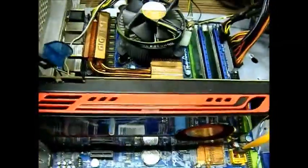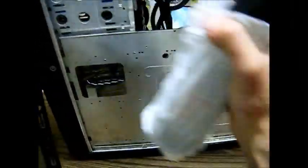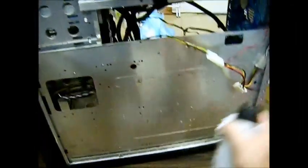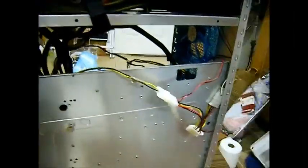I just cleaned off my video card, stuck it back in, and screwed it in. Now it's time for the video capture card. Like I said, it's a PCI card and you just stick it within those slots. Before we put the back back on, you know, have one last spray of the back side — make sure there are no pieces of dust that might have got stuck somewhere. As you can see, I put some of the wires back here just so it looks nice. You might also want to give the front and back portion of the case a wipe.